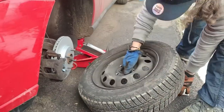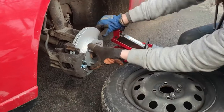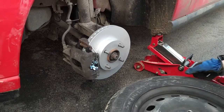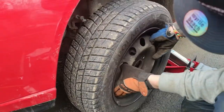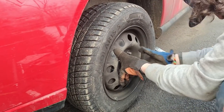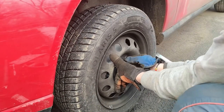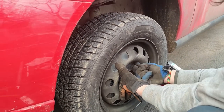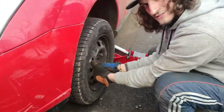Take the wheel — it will also hold your brake disc in place, so don't mind if the disc moves a bit. Catch it with the four wheel bolts. After catching the wheel, make sure everything is tightened, then lower the car and move to the back to continue with the rear wheel.